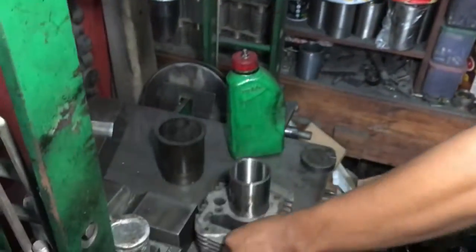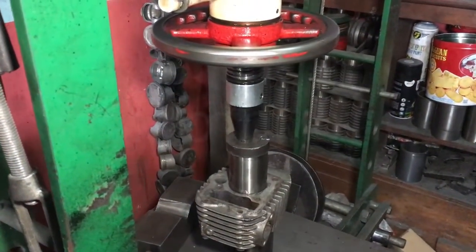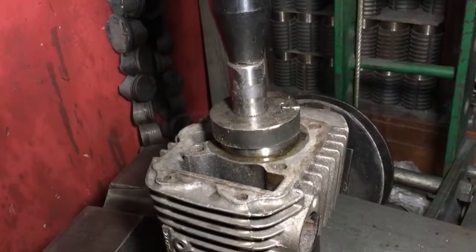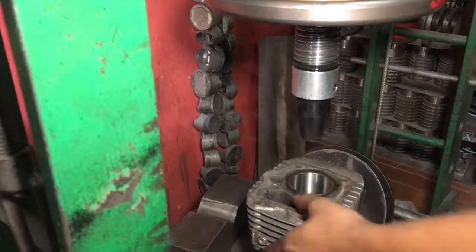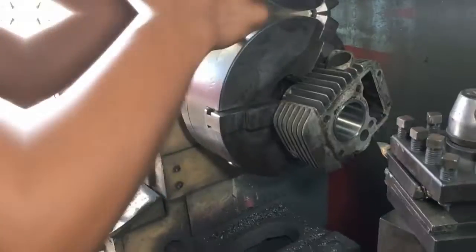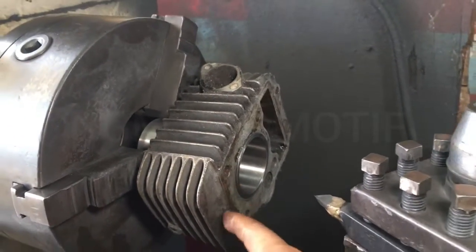Okay friends, this is now stage two — after enlarging the diameter, we will now do the pressing to install it into the block. The lathe sizing must be exactly right, because if it's pressed incorrectly, the cylinder or boring can crack, or it will become loose when hot. Pressing is now complete. We will lathe it again — it needs to be leveled. After pressing, the cylinder still sticks out and must be made flush; otherwise compression can leak and it cannot be assembled because it's too high.